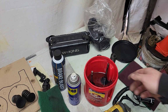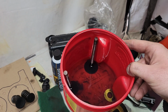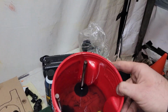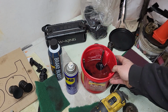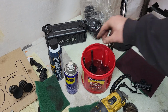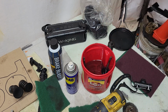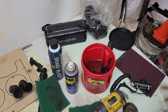Okay, YouTube, before we get started, I just want to show you this. This is what I normally do. I take the valve out. So like when I'm working, say, on that one, I can have these ones in soak. So if it takes me like 15, 20 minutes, they're in here. And what I'm trying to do is soften off all that baked on carbon that I'm about ready to show you how I cleaned it off. So yeah, I usually use diesel, or you can use Varisol, or some people like to soak it in WD or whatever kind of chemical you got. But I always find diesel fuel and Varisol is the easiest and cheapest and the cleanest.